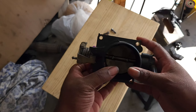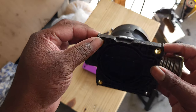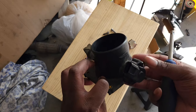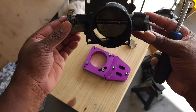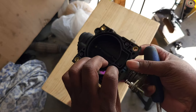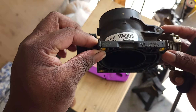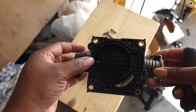We have to notch out one of these brass rings. I'm going to use a one-fourth or 0.25 driver to notch it out. When you flip this over, this is where your cables need to go on the Focus, so this brass ring will be on this side. Here's a word of caution: this brass ring is inserted into really flimsy ABS plastic. If you have a 2004, 2005, 2006, or 2007 Focus, it's gone through many heat cycles — you need to be careful, otherwise you'll snap it.